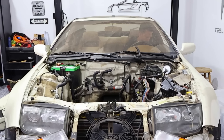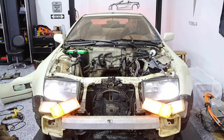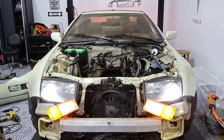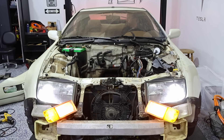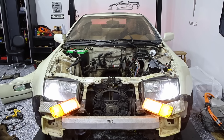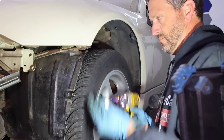I should mention we took out all the fuses we thought were related to the engine and kept everything else. Right away the interior lighting is working, and I can verify the stereo is working too. So let's start: park lights, headlights, brights, fog lights. We'll do the blinker — oh that's interesting, it's going fast. Blinker, brake lights, horn, windshield wipers. This actually has a rear windshield wiper. Power windows — check. We've got power mirrors. All right, now that we've got a good baseline of all the systems, we're going to remove as much as we can.